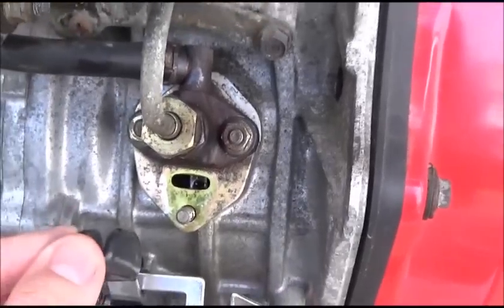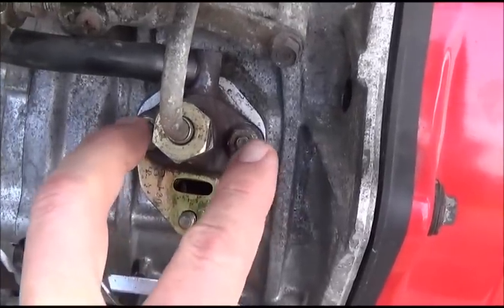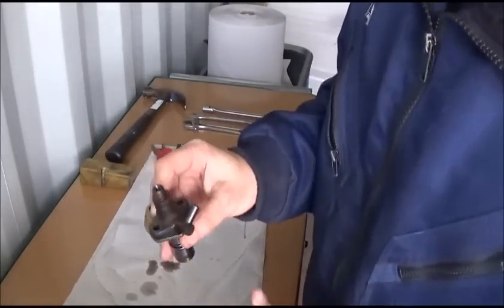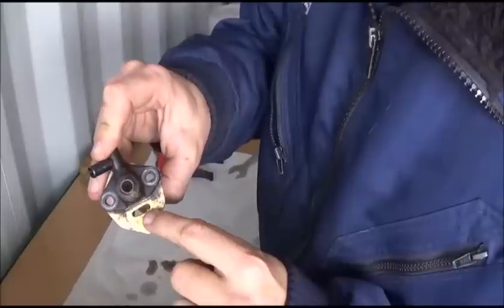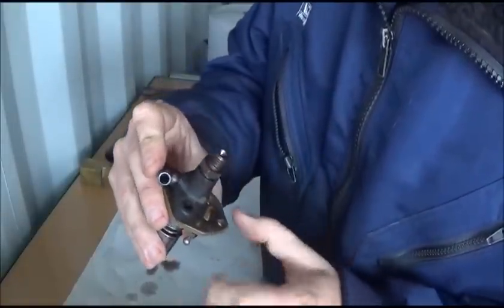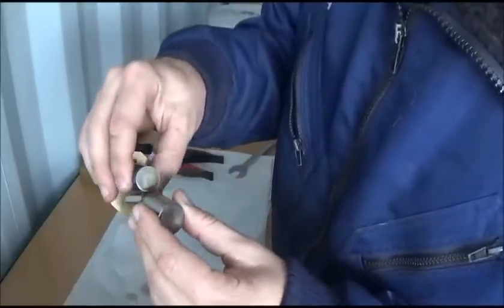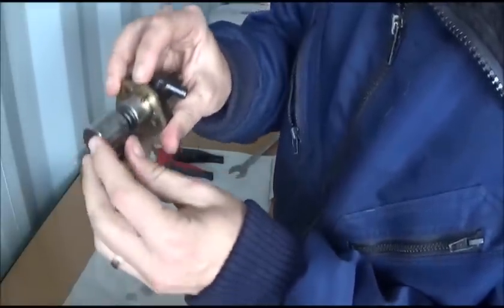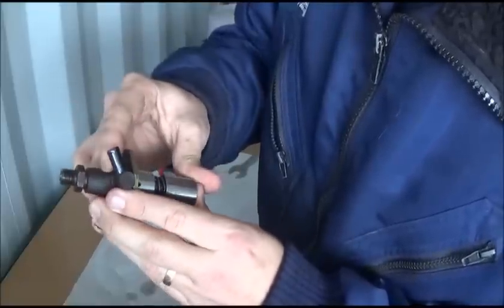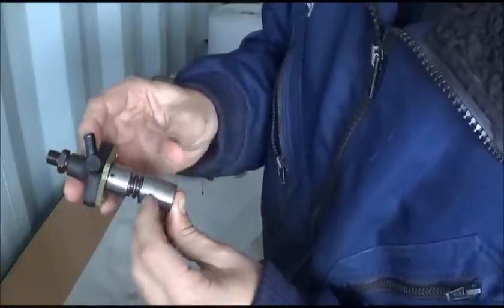You can pull on the starter as much as you like but you're not going to get any pumping because there's no displacement of the plunger. We have to remove the two nuts on either side of the outlet side of the pump, remove the fuel inlet hose, and take the whole assembly out. With the entire assembly removed, we can see the window where the needle was, the valve assembly on the outlet side, the inlet side, and when flipped over, the cup acting on the spring with the plunger inside. The cam rides against the bottom of the cup and pushes the spring up and down. If the spring is fully compressed, you have no displacement and therefore no pumping action.